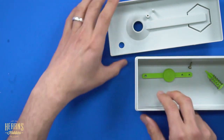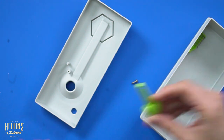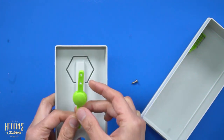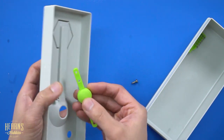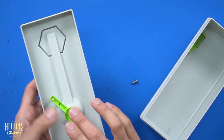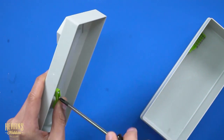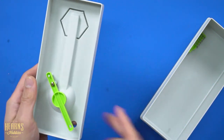Let me show you how it goes together — very simple. It just has one Phillips head screw and we're screwing in the valve. The valve has a silicon part — make sure you don't lose or drop it because that's the part that seals it and stops water from dripping everywhere. Get the two holes to match the two marks, turn it so the rubber faces the right way, place it on, and screw it in until it's just tight. Don't over-tighten as that can split the plastic.